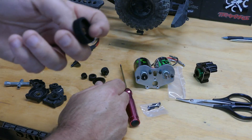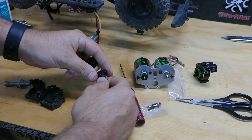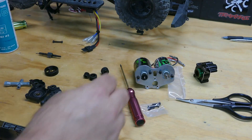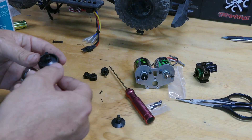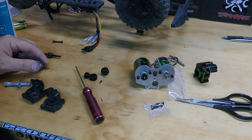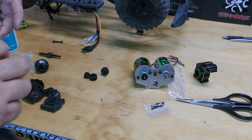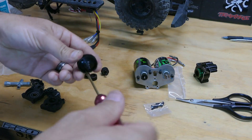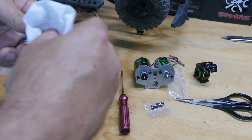The plastic is gone, this is chewed up even a little bit here. We'll clean it off and line it up on here. Since we're going metal to metal, we're actually going to use some blue Loctite here - just want to make sure these are in there nice and secure and will not be coming out unless we want them to. We'll dab that excess off and snug it up, then quickly get the extra Loctite off of there.